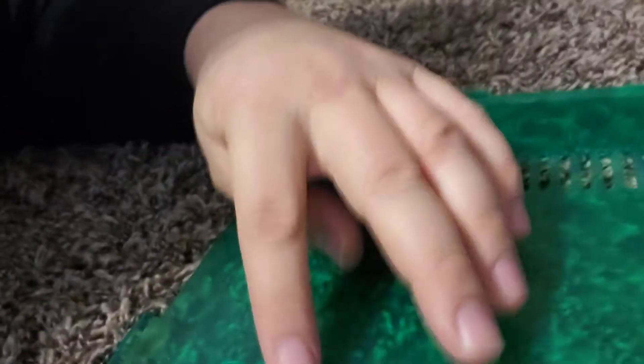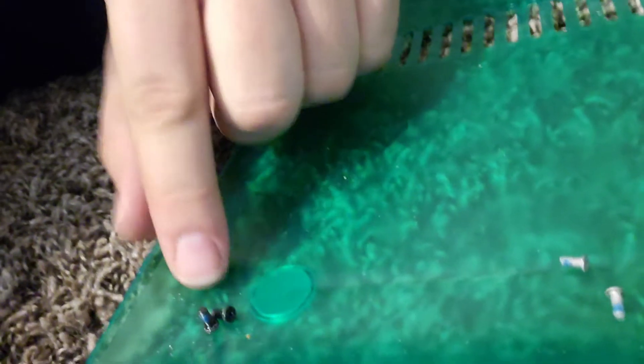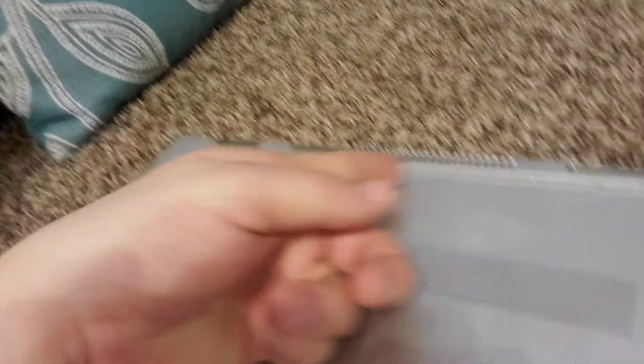I got my screws — you want to put your screws in a safe place. Here are my three T5s, and I got a couple of my Phillips here. The other ones are still in the laptop. I had to peel off the back adhesive to get to it. There's back adhesive on here; I peeled this strip off, but the adhesive stayed on there. So I definitely want to be careful and try to keep that as sticky as possible. You can buy adhesive tape on eBay — I'll put a link in the description for that.